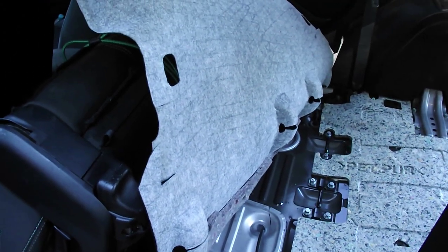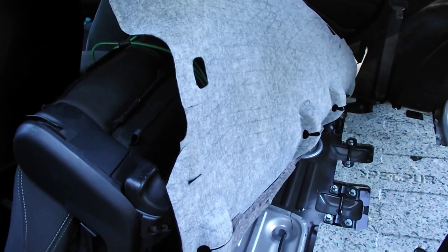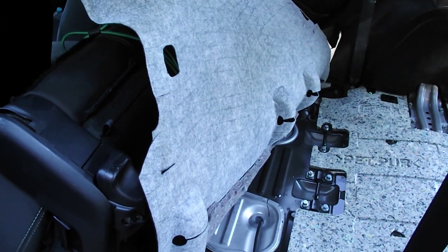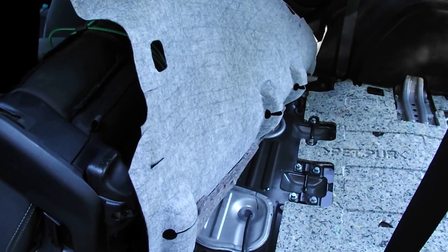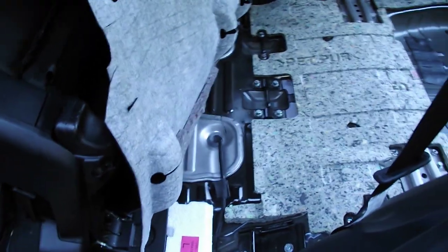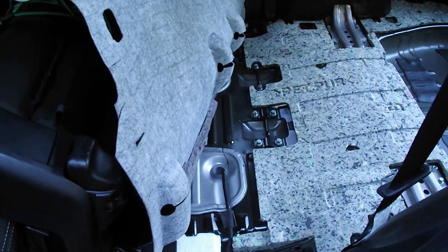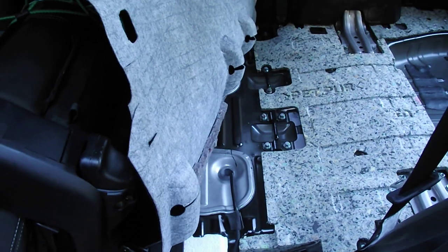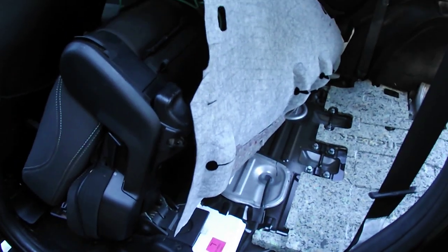The correct way to do it, according to all the information I have, is to remove the fuel pump relay from your relay or fuse box, then run the motor. The motor will stall, and then the pressure is gone, because it's somewhere around over 30 psi in the tank. So please be careful. Don't go killing yourself over changing a filter. And the other thing is, I always take off the fuel filler cap, but that doesn't depressurize in itself. So do take the relay out. I've done it on other cars, which were a bit simpler than this.